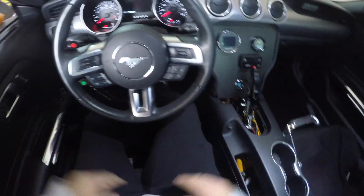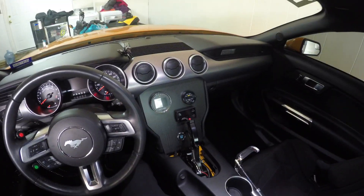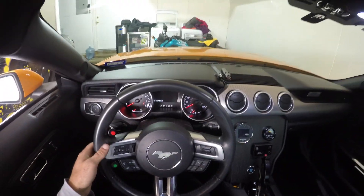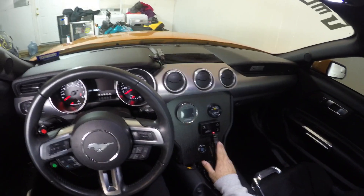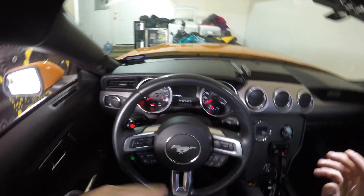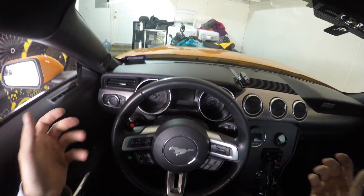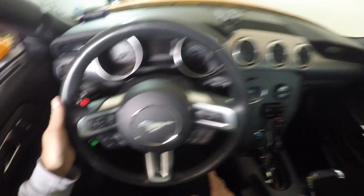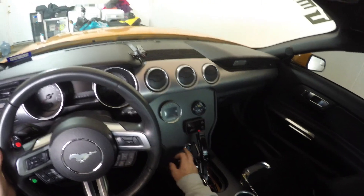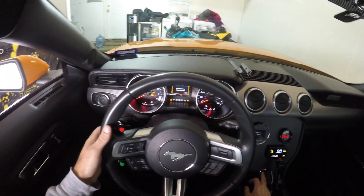A lot of people have been asking me to show how the car works with all these fancy buttons and gauges. Today I need to check the trans fluid, which means I need to drive the car around, get it up to temp, then come back and check it while it's idling. The car is a little different because it was an auto car and now it has a TH400. Lund had to flash the PCM to make the car think it has a manual PCM, and with a manual PCM the car needs a clutch signal to start — you pull the left shift paddle, which sets the clutch, put your foot on the brake, and then ignite.